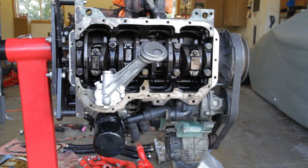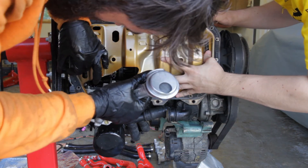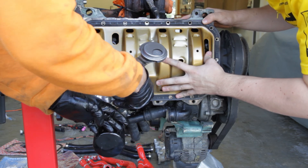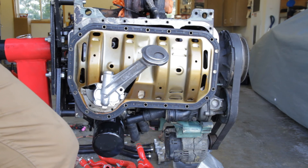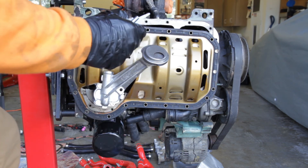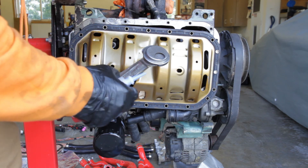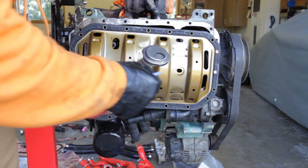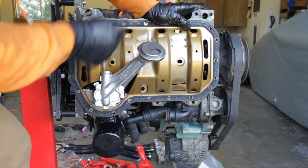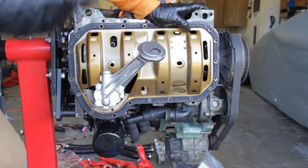So we can get the baffle on. I just realized — do as I say, not as I do. You're going to want to put that on there because I don't think it will slip over very easily — I probably could have just checked, but you're going to want to put that on first. Thread locker works, it's a magical thing. Basically when it doesn't get to see any oxygen or at least air, it hardens. You'll get a container of it and you'll see that it's like all air and you'll be like, what the hell, did I get scammed? Put a little bit of thread locker — just a bit of it. These are all seven foot-pounds. The weird thing about this is it is kind of difficult, apparently, to get the transmission on if this oil pan is on here. I think it's because of the weirdness of the different oil pans, but they work. So what we're going to do is we'll put these on, but we only hand tighten the bolts just to keep it on.